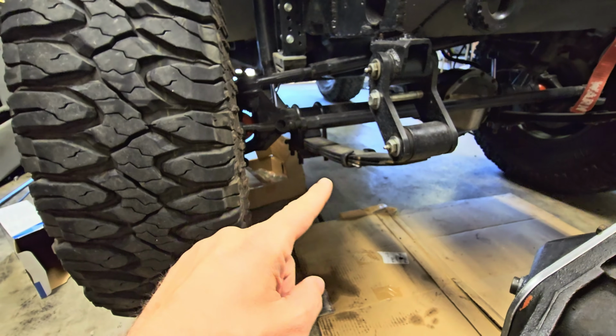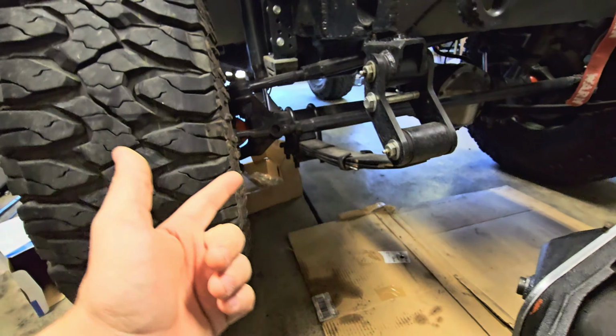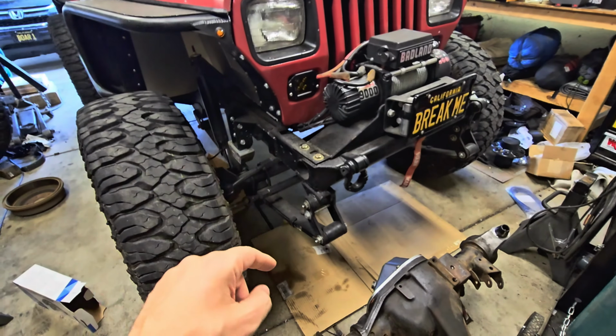Eventually, we're going to put hydraulic assist on in here. I've got most of the parts. I just need to do the steering box part. And from my experience, when you put a hydraulic ram on with really soft suspension and no sway bar, it makes the sway even worse. So don't want to mess with that on the highway.